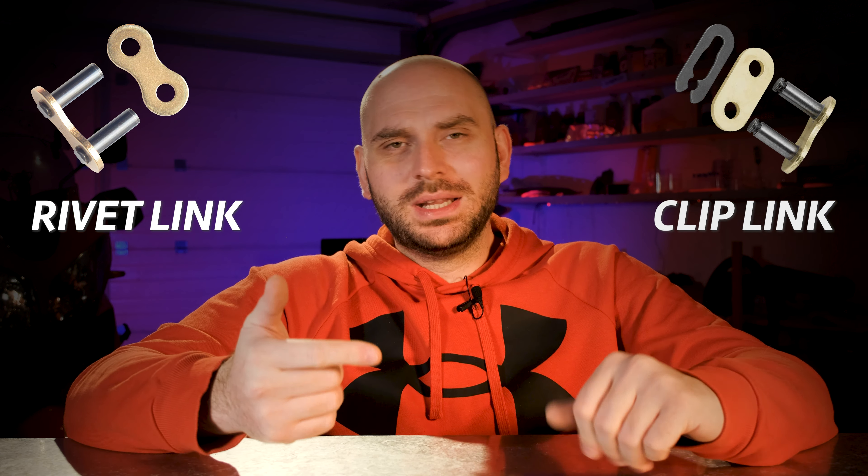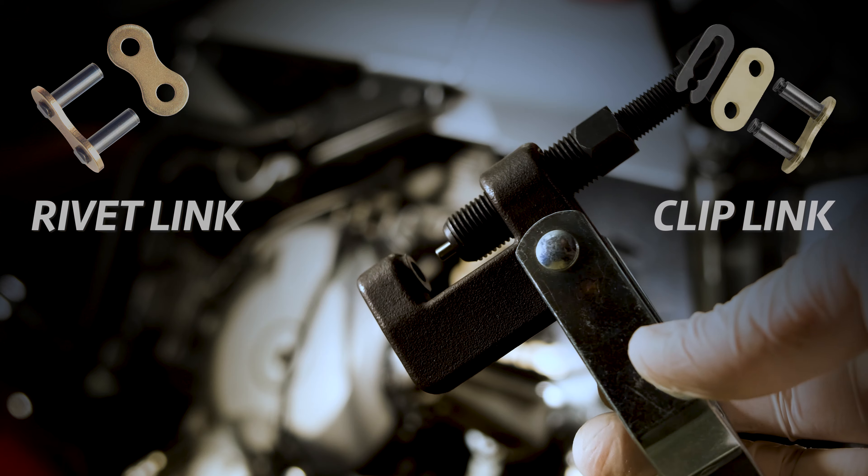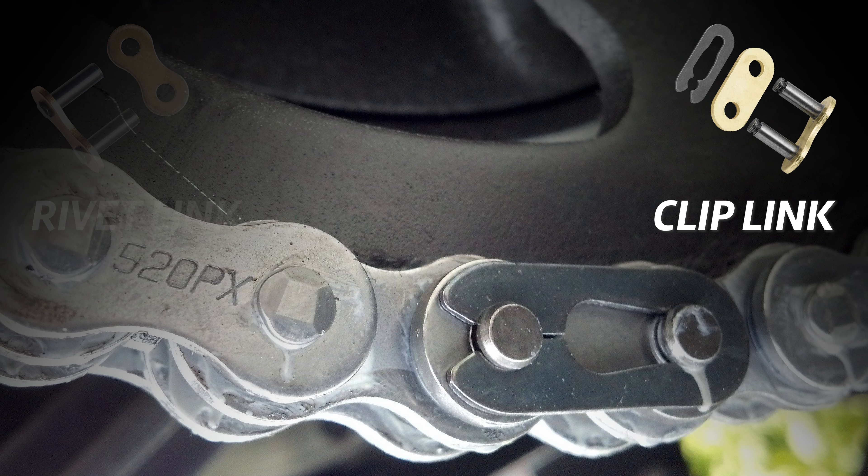When it comes to the brand, I highly recommend going for established brands. A higher price usually means better quality. Cheap chains are cheap for a reason and usually imply lower quality alloys, bad surface treatments and sloppy tolerances. The master link or connection link is what binds your chain together and there are two types: a rivet type and a clip type. A rivet type should be more secure, but you'll need a special riveting tool to install it. A clip type uses a clip that slides over the pins to secure it in place. These are arguably less secure as the clip can pop off, but I've used clip master links for a very long time and didn't have any problems. It depends on your riding style.